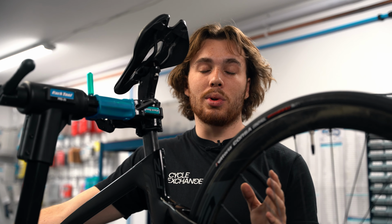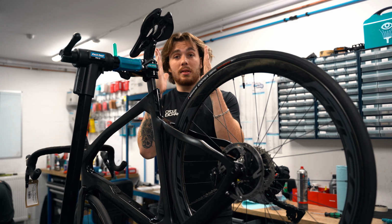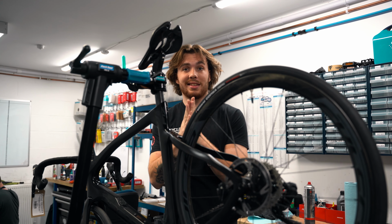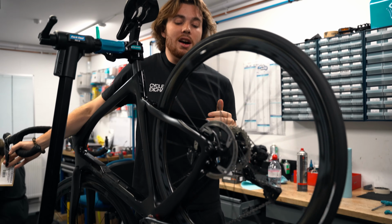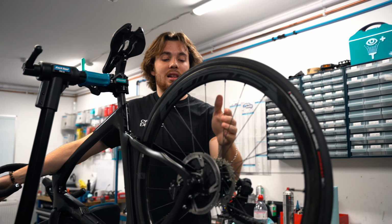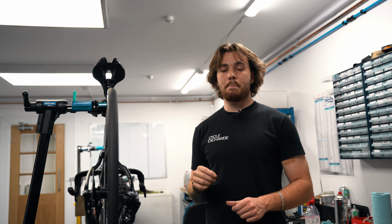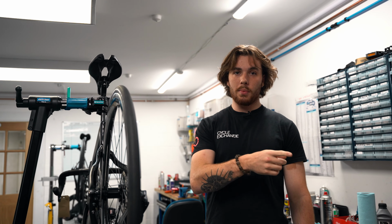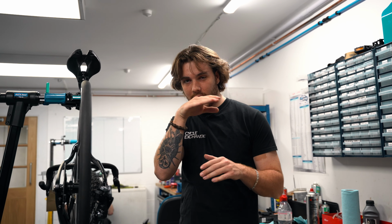Now the disc and the caliper is all aligned, your brake will actually feel a whole lot better. That's because the pads are biting evenly, real nice, so it feels nice, crisp, Shimano Dura Ace bite, you know? Give it another spin, give it a little test. Lovely. Excellent. On that first ride, brakes aren't gonna work too well, so what I recommend doing is bedding your pads in. So go outside, do a couple sprints up and down the road, grab a handful of back brake, and just take that first layer of brake pad off, and they'll be biting like perfect after that, hopefully.